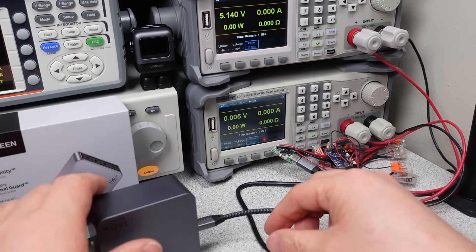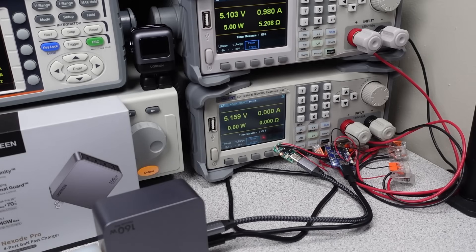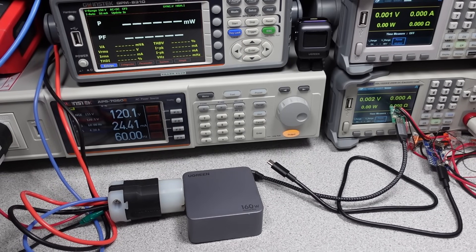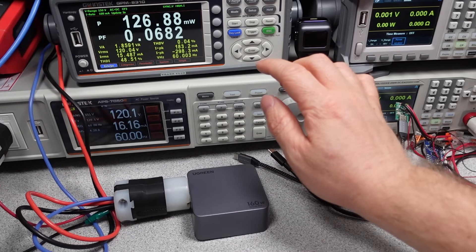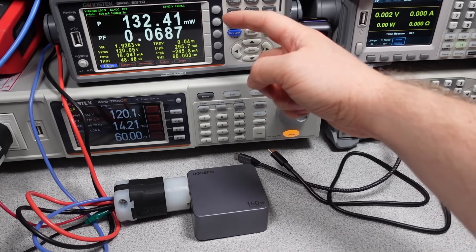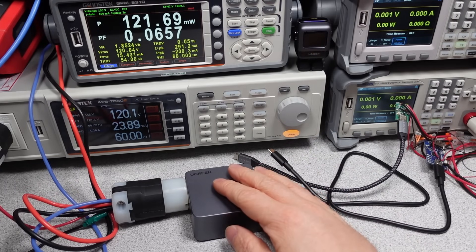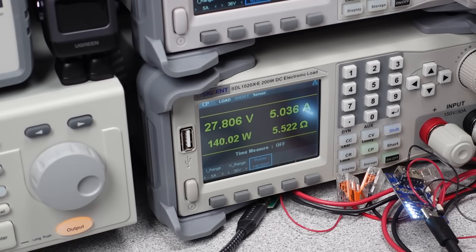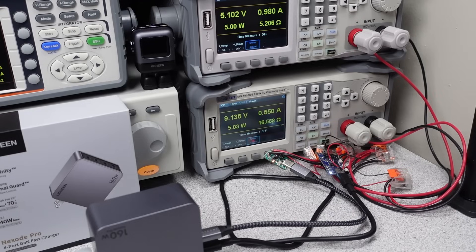This is a step in the right direction — this power adapter is a lot better than older chargers on the market. The AC power supply supplies a controlled clean voltage for testing. The power adapter, once plugged in, settles down to an idle power usage, and for this wattage class this adapter is excellent. The idle power usage is class leading for a 160W power charger. Once we put a load on the device though, the data shifts in the other direction — the power consumed starts to go up faster than I'd like, which undermines the marketing claim that it is more efficient.